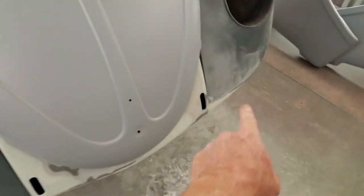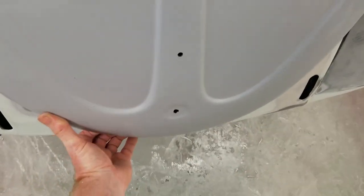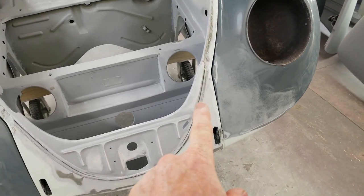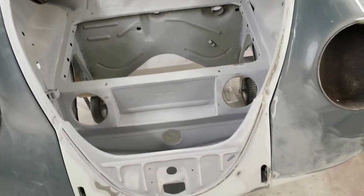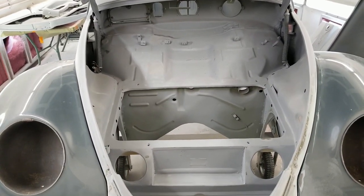And then back here, this is actually good. So when I bolt it on, it's right on the money. So just a little tweaking of one of the glass fenders. We brought this down, brought this one up a little bit, and we're pretty good. Next thing for us is getting this area corrected. Hood sits a tad high here and still a little bit there. I brought it down and a little bit forward to straighten her out, but still a little bit off. Other than that, we're getting closer.